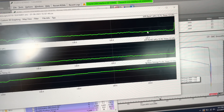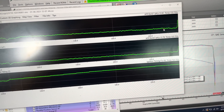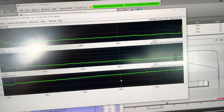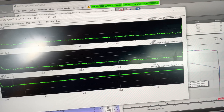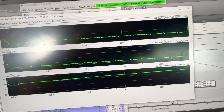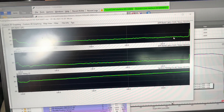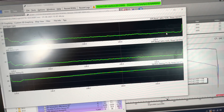This is the data from the full throttle run. The air-fuel is pretty flat — basically 12.7 to 12.8 all the way across with minimal fluctuations. Ignition timing starts just below 20 degrees, creeping to just past 30 degrees at the very top of the run. This is on 93 octane. This is just so you know what the air-fuel ratio data looks like right now. We're going to swap injectors, run it back, and after that tune the car on E85.